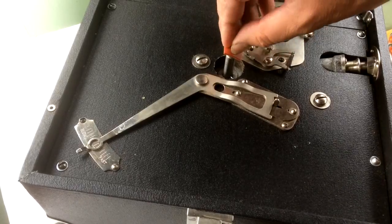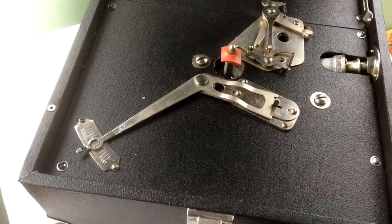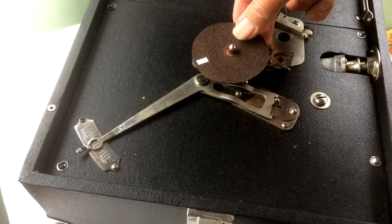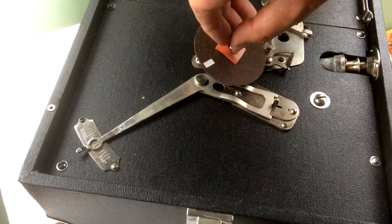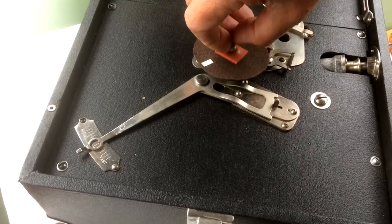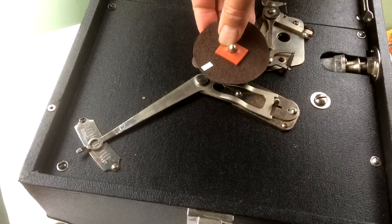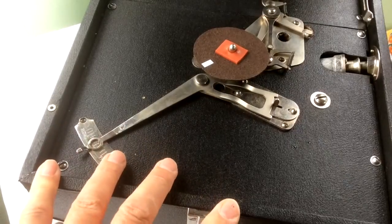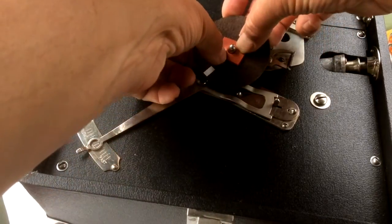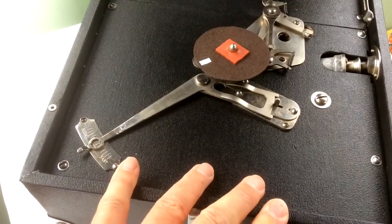got at the spindle. And to do that, we could use either the strobe disc, which I showed in an earlier video, or I can use a digital tachometer, which is what I'm going to use in this instance. So I'll just load that spindle with the disc that's got the reflective tab on it. Try and get that a little bit flatter. There we go, that will do.